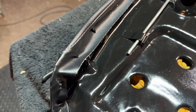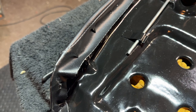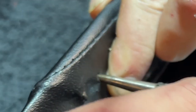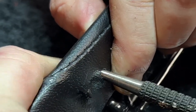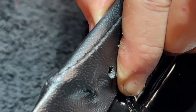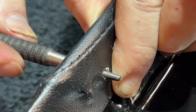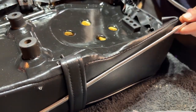To do this I'm just going to use a little propane torch, heat up a punch, and basically melt my way through that vinyl at those different spots. Just heat this up really, really good, then go around and do each one — be sure not to point your fire at your seat like I'm doing right now. Then come around on this end and push through like butter, nice and level. There we go — we just got to get through the seat. You can see it kind of protruding there. That's a nice clean line. I'm so glad I didn't try to drill this — melting it is the way to go.